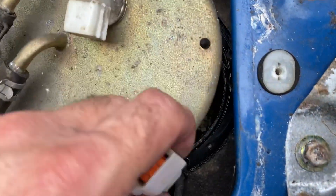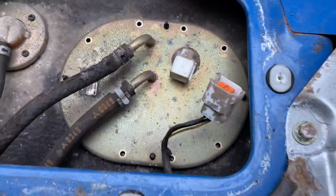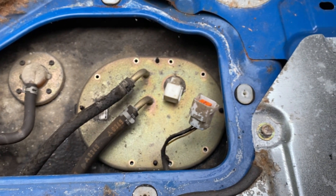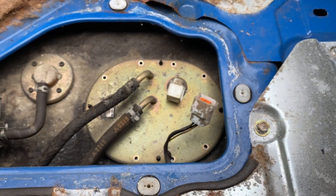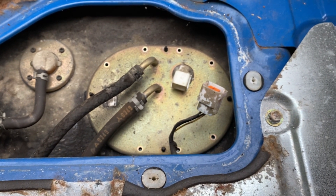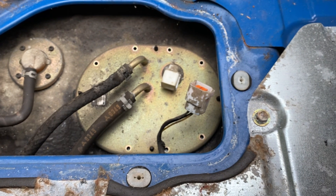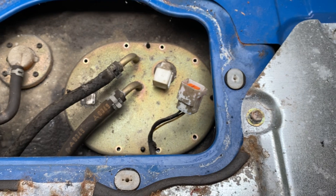We're going to close this up to try to get some of the vapors to stop coming out. Be very careful if you're doing this job — make sure you're in a very well ventilated area. I'm outside right now with the door off and there's lots of air coming in. Check that before you fire up a car that's been sitting for a long time, just in case the fuel pump is still working and it manages to suck some of that rust up and put it into your fuel lines or into your motor. Anytime you get a car that's been sitting for a prolonged period of time, good idea to check that.